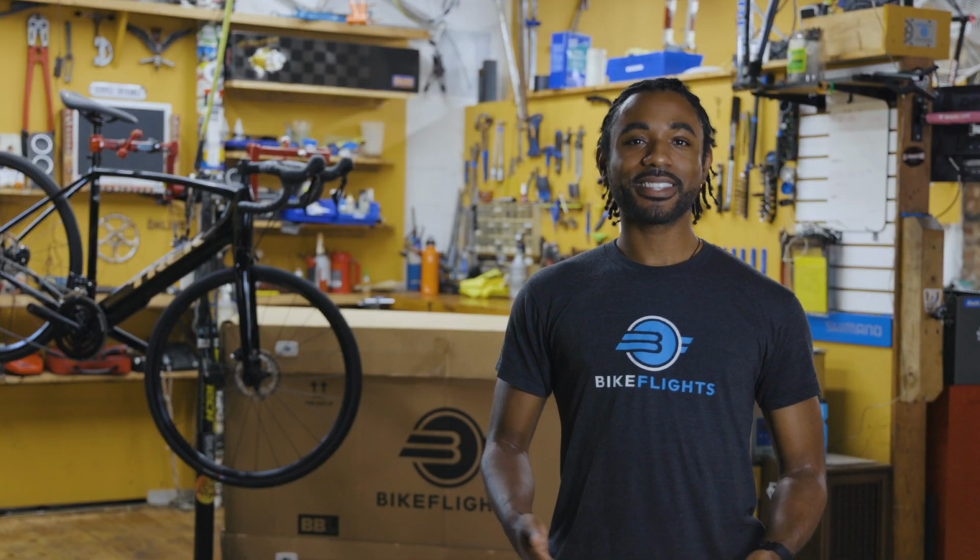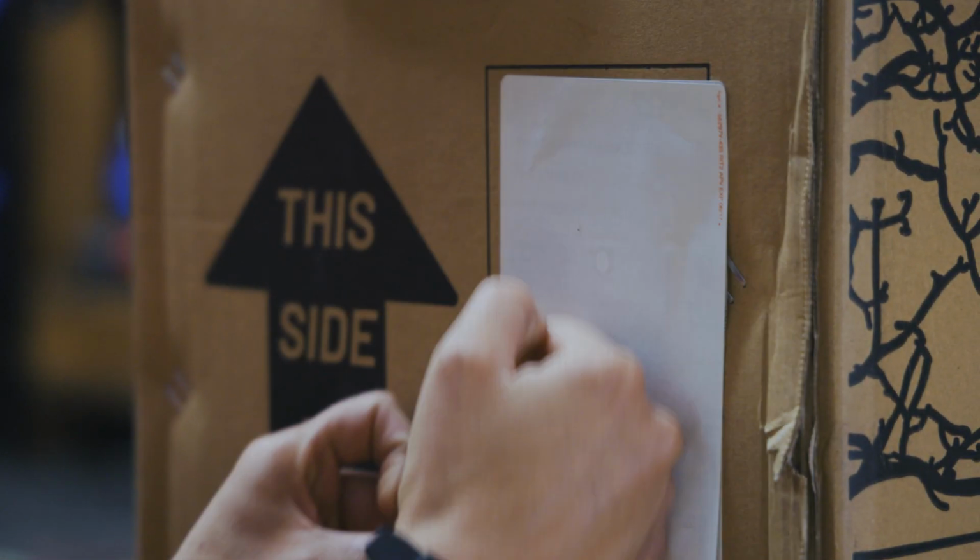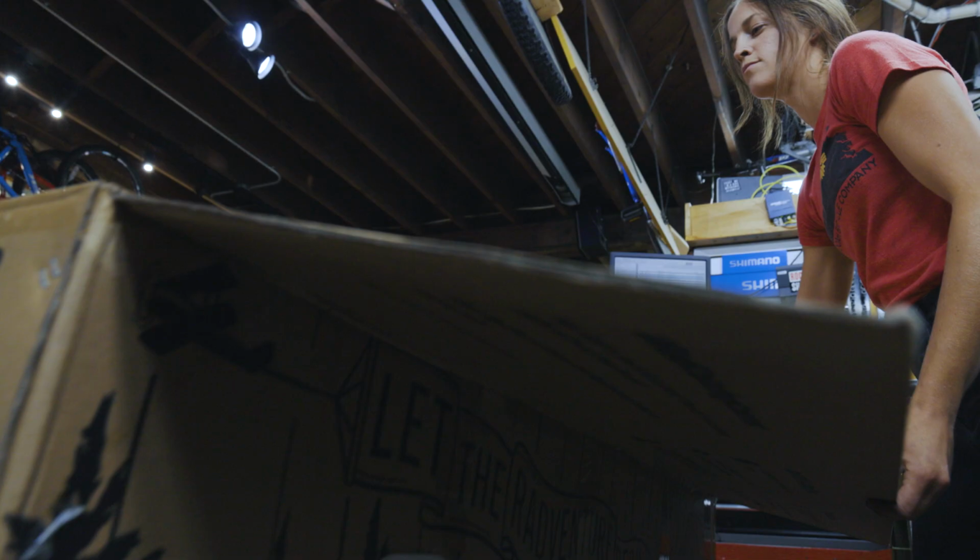Remove or completely cover all bulk shipping hazmat markings. Even though these stickers are required when manufacturers ship multiple e-bikes together, you don't need them to ship a single e-bike. In fact, if you don't remove these stickers, your e-bike could incorrectly be treated as a hazmat shipment, which means it may be stopped, or, worst case scenario, tagged for disposal.